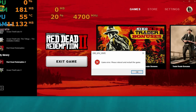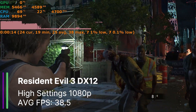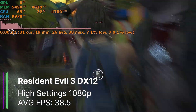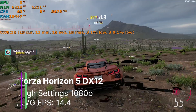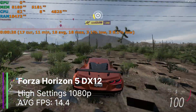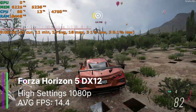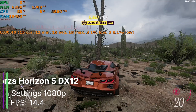So it's quite clear that not all games are currently compatible with the MTT-S70. One game that did work well was Resident Evil 3. Here we had the settings on high at 1080p, and we got an average of 38.5 FPS. The 1% and 0.1% lows were not the best due to some stuttering — 18.4 and 6.5 FPS respectively. Around 40 FPS on average isn't the best, but at least you can actually play the game. The same can't really be said for Forza, which whilst it did work, looked like a game of chess. In Forza at high settings 1080p, we got an average of 14.4 FPS, with a 1% low of 6 FPS and a 0.1% low of 2.6 FPS. Even turning settings down wouldn't fix all the graphical glitches.